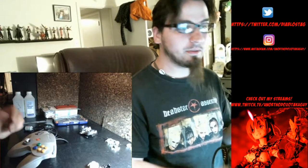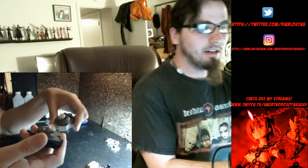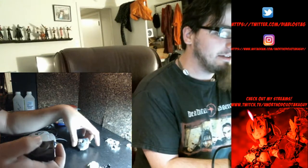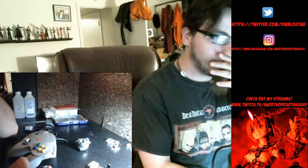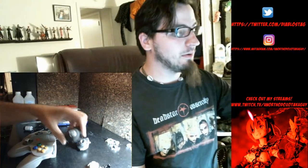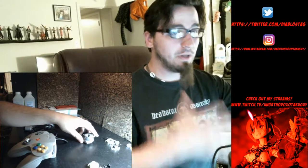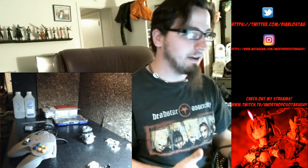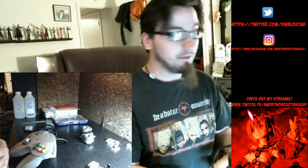what I can recommend for anyone who has a Nintendo 64 controller, I always recommend doing a rebuild on the control sticks, because the control sticks are mechanical, okay? And they have specific parameters and sensitivity that work really well with how they're designed. If you replace them with the digital ones, which are pretty common in the aftermarket now, they are extremely sensitive. So when you're playing racing games or shooting games, or you're trying to tiptoe as a character with a digital stick, it can have some repercussions.